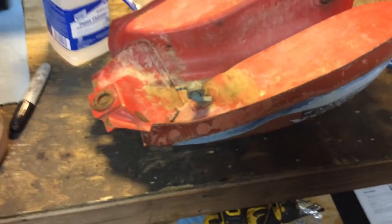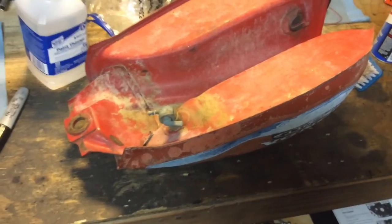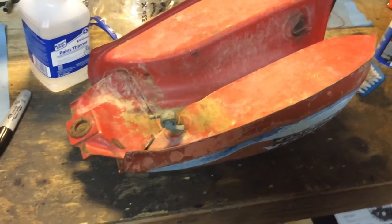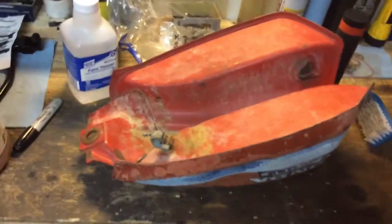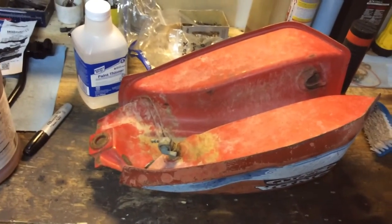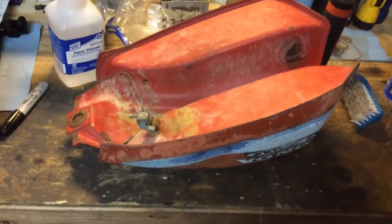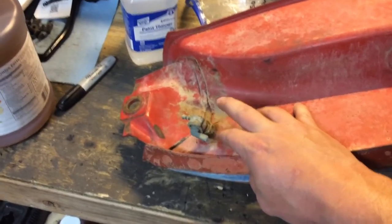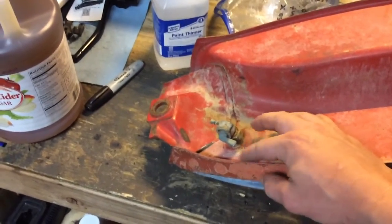What I was going to mention is I tried The Works Toilet Bowl Cleaner before — probably similar in price because you can buy it at the dollar store for about a buck. I think I bought like 16 of them, and it's a pain in the ass to pour in. It's supposed to be way faster, but I didn't have very good results like a lot of the other three-wheeler guys do. Maybe I just didn't do it right. But I've cleaned four, five, six gas tanks like this, and apple cider vinegar is what's worked best for me. So I just put the petcock on off. For tanks like the 125M ones that don't actually have a petcock — they just have the regular flow line and the reserve line — I just took a hose, put them on each one, or one hose between the two, and then hose clamped them so neither one leaks.